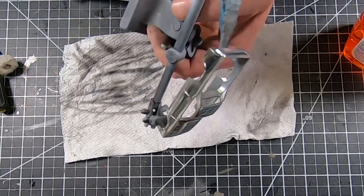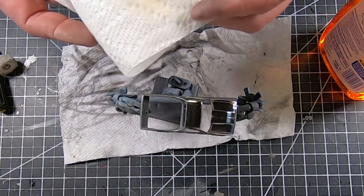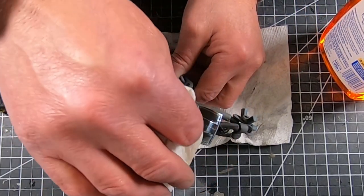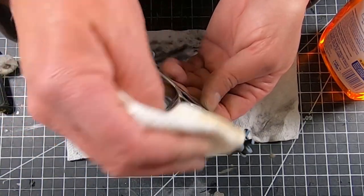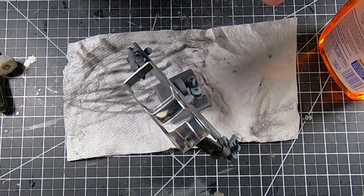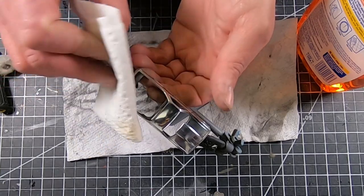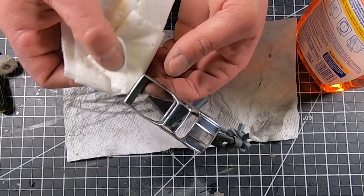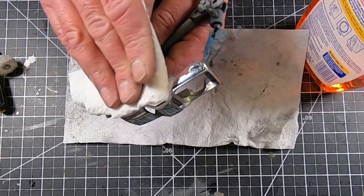This is the finished polished result. Came out pretty good — I could have gone further but I didn't. After that, to get all the residue off I'm just using this Zep cleaner. You can see it looks really clean. I'm getting ready to paint, going to clean it again — you can see there's still some black stuff to remove. The biggest thing is preparation for any kind of Spectra Flame or candy paint in general. You have to really make sure the substrate is clean and neat.